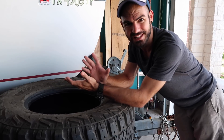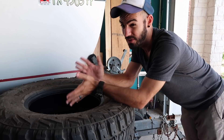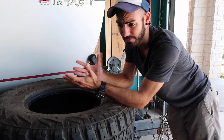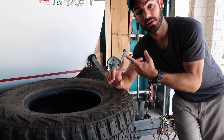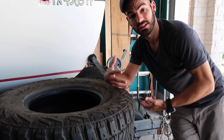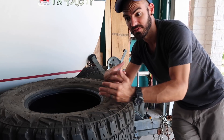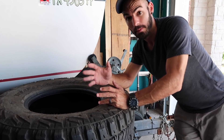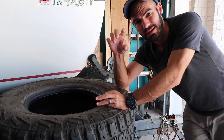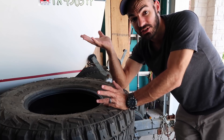I was considering the Dobinson extended-reach 3-inch true lift, which is around $500 without assembly — I can do that myself. I know I'll need upper control arms. If I replace my front strut assembly, I can sell the TRD Pro suspension for around $400 or trade it for upper control arms. I'm also wondering whether a spacer lift is even an option — do they sell 2-inch ones? That would let me keep my TRD Pro front suspension, though I know it's not the best choice.